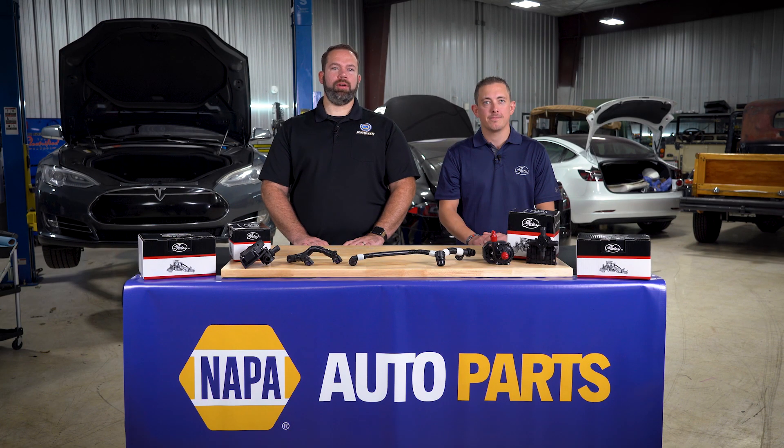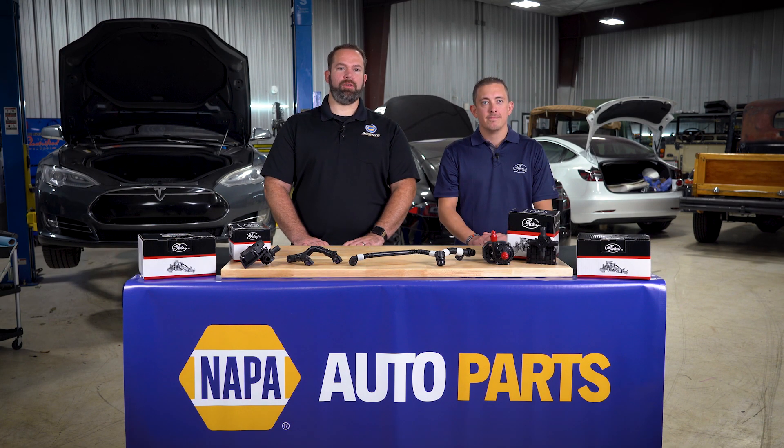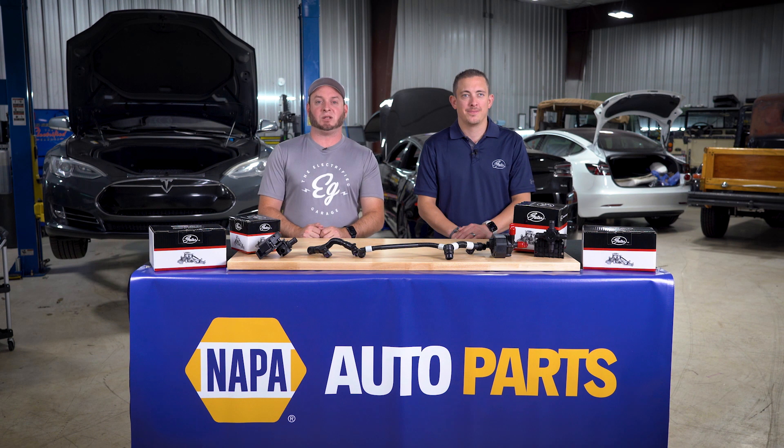So now we're going to rely on Chris's expertise and years of experience working on Teslas to walk us through the installation process. Hey guys, this is Chris from Electrified Garage. When working on an electric vehicle it's important to isolate the high voltage system — this ensures that no one gets hurt while working on the vehicle. After safety isolating the high voltage system we're going to carefully raise the vehicle to drain the coolant before replacing any of the parts.